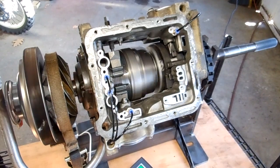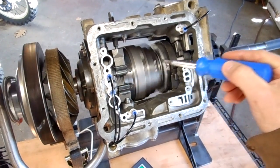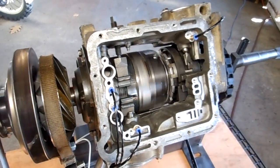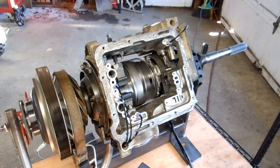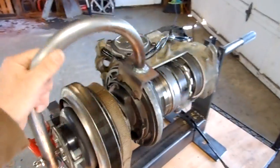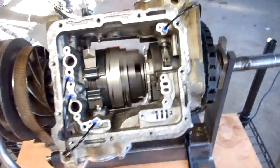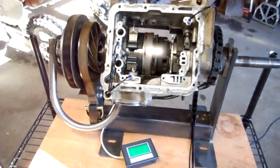Now I'm going to engage reverse. It will release the forward clutch. It's going to continue using the reverse clutch, but it's also going to engage this reverse/first gear band. And here is reverse. You can see the output shaft is moving in reverse relative to the input. This whole model is free to rotate, so we can see everything operating. And that's it.